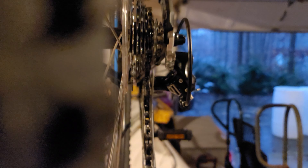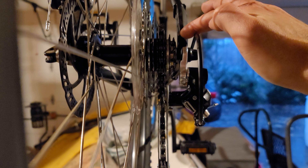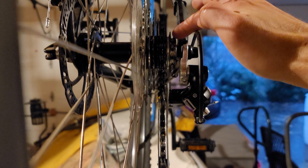The back wasn't too much of a problem, at least not as bad as the front. But the back, it's all about getting this bastard right here with these teeth. I can see it aligned to whatever gear you're in. So you want to go to the lowest one — basically get it so it's like falling off. And then you're going to adjust the high over here, get it to where you need it, so that it's not falling off.